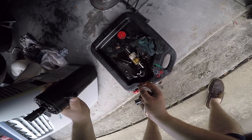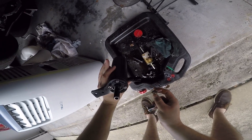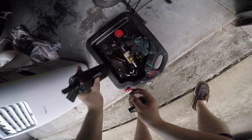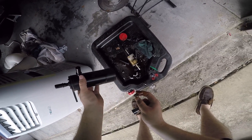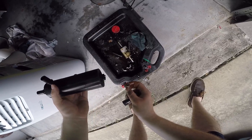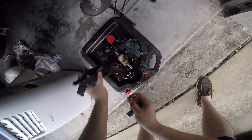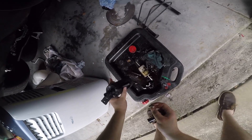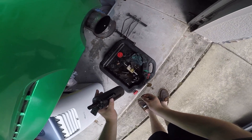Definitely a lot of oil there. It's not even very watery — a lot of people will say sometimes it's watery from condensation, and that's what most of it is. But that is a lot of just straight oil. And this prevents all of that from going into your PCV system. We're just going to shake this out, put our drain cap back on, put it back in the car, and let it do its work.